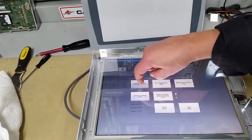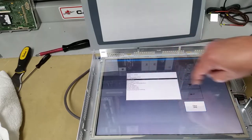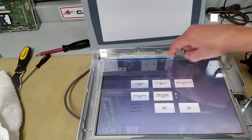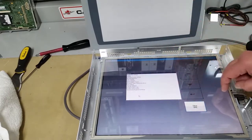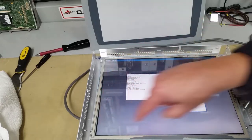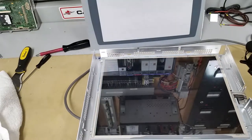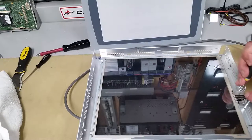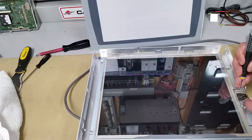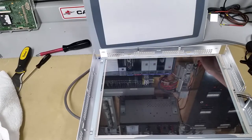Okay, so now we're booted up. We can double check all of our screens with the glass — there's no application. You know that the glass is good, your touch screen interface. Before I put it back together, this has all got to be clean because my fingers are dirty. Now that we know the trick on this one, we push the little clip down with the screwdriver and it wiggles out without any fuss. Next step is to remount this into the bezel, and here's our new overlay.